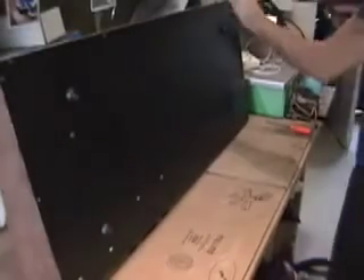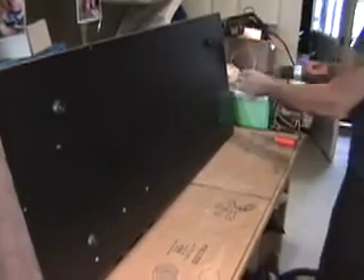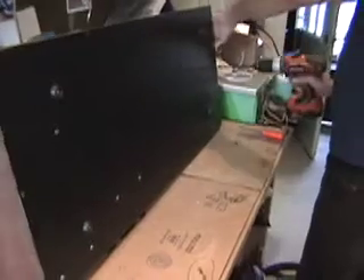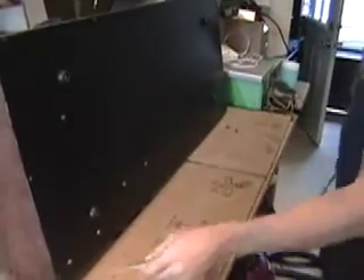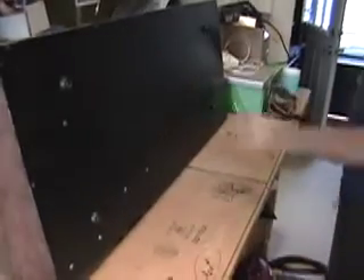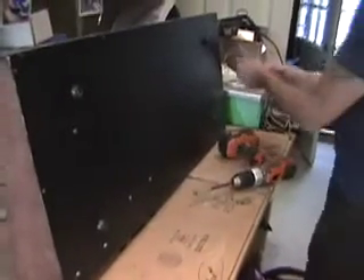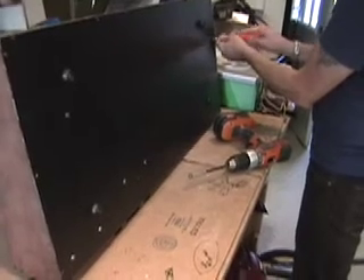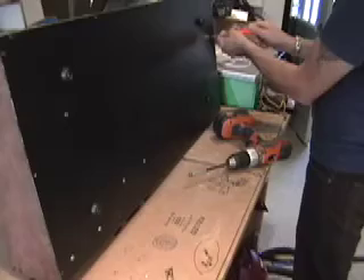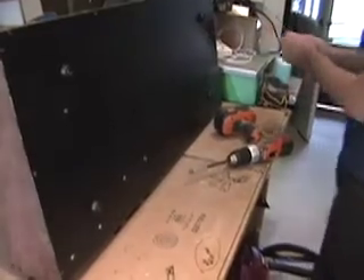What we do is remove all the screws underneath the keyboard. You have a line of screws on this side, this side, and the top. Then there are two flat head screws that you have to remove. Once you remove them, we're going to put this down and remove some more screws from the back.